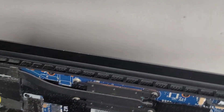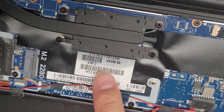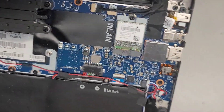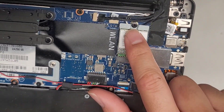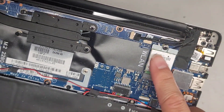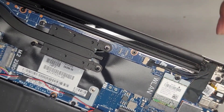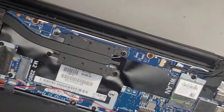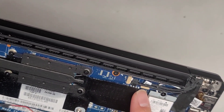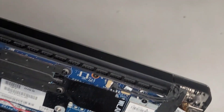I don't know what happened, but it looks like some grease or something leaked out and discolored the sticker. There's the wireless card here — one screw, a metal plate comes off, and then you pull up from the tails to pop out the antenna wires: the white one there and the black one there. The wireless card comes out by going up at an angle and pulling it out, just like the SSD. There's a cable going into the screen, as well as this one — probably for microphones and cameras.